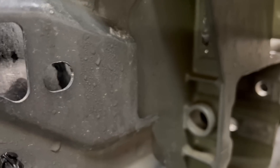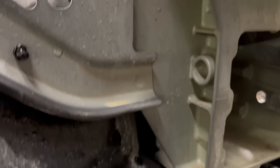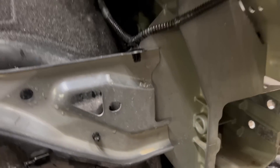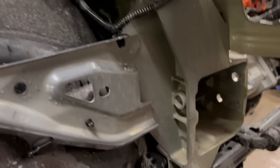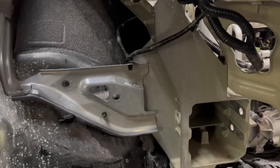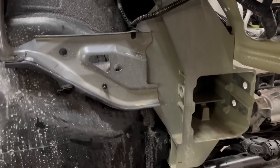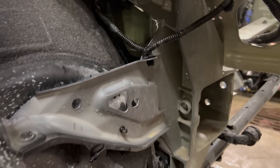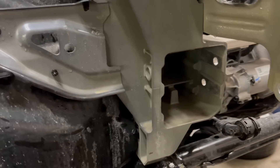It would be clever if this entire wing bolted to this assembly instead. I know it's probably easiest for them to build it into the die, but I think maybe that's the wrong move here, because it appears that in just about any front-end accident, that's probably the most vulnerable part that snaps off. If it's not something that has a repair procedure or is easily repaired, there's going to be a lot of these things written off just for that tiny little wing being broken off the cast member. Maybe an update in the future where that piece would be independent from the gigacast instead of incorporated into it — just my two cents.